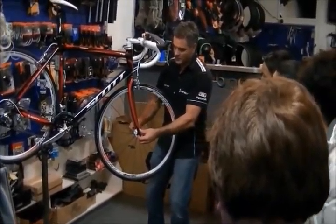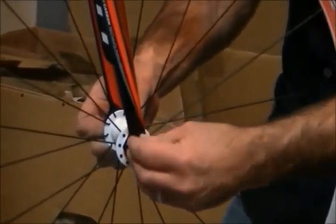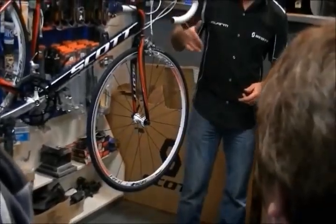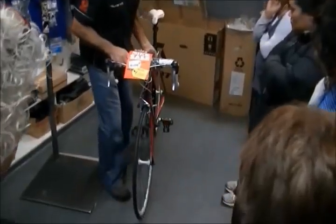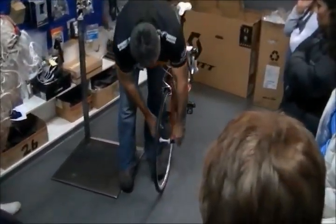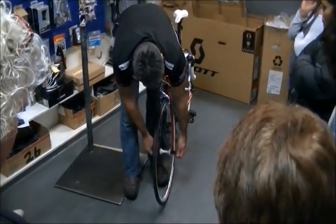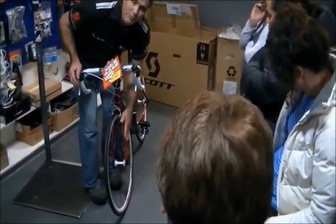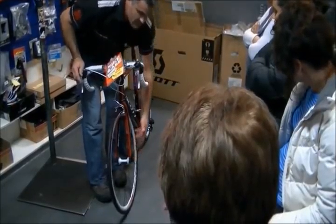Pull the wheel up and clamp it. Always make sure the wheel is in properly — put the bike on the ground, undo the quick release, let gravity push the wheel right up, then clamp it properly. Always clamp with the quick release lever pointing up or back, not forward. If it's pointing forward, there's a chance it could clip another person's wheel and undo your wheel.